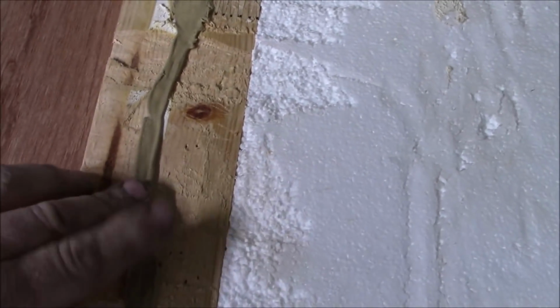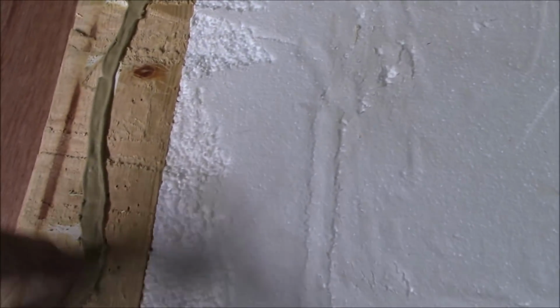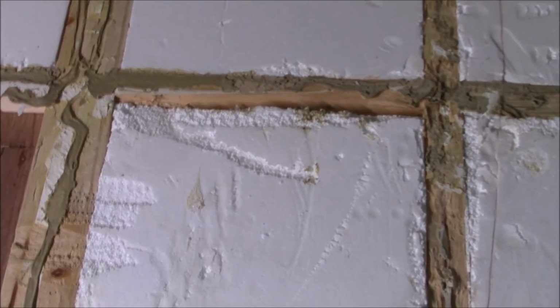Like I was showing you about this glue, you can see it's got big clumps in it, so it just didn't hold very well at all. It released. I don't know what brand it is, but this is just a regular underlayment type glue. That's all it is. Sometimes if some moisture gets underneath there, it will release, and that may have been what happened. The products we use, it doesn't do that. Actually, the products we use are moisture cured. So if moisture hits it, it's actually a help. It'll help cure it out. But that's where we're at so far.